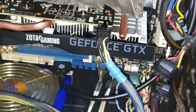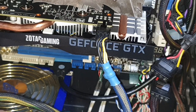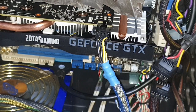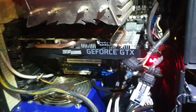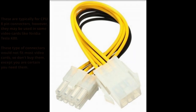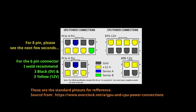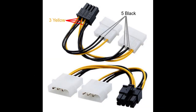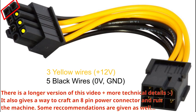The simple answer to this problem is to just buy a proper connector with eight pins instead of six — or even better, if you have a power supply with an eight-pin connector, that should work. However, there are a lot of connectors on the market, and some have four yellow and four black wires — those won't work. What you have to look for when buying is a connector with three yellow wires, which are 12 volts, and the last two pins should be black.